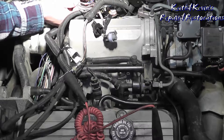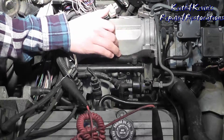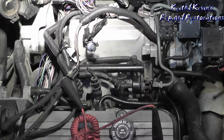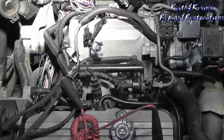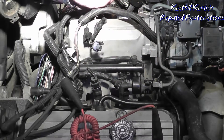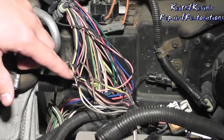I want to fix the problem and do it correctly the first time. This didn't take a computer diagnostic, but it did take a simple digital voltmeter like this one I've had for many years — the continuity tester is the big one. Let's get down to the repair. We're going to cut the bad wire out, put a cheater piece in its place, solder that in, put this thing back together, then test and run to see if we've solved it.